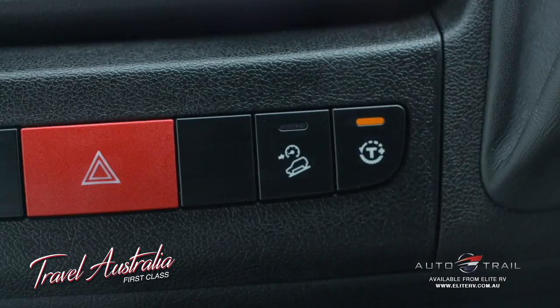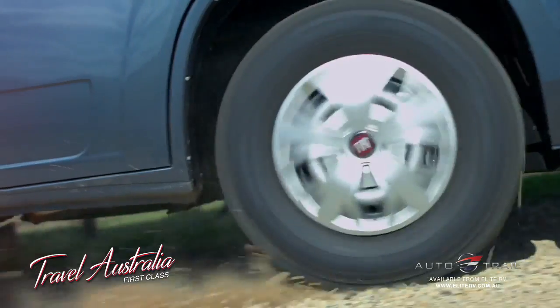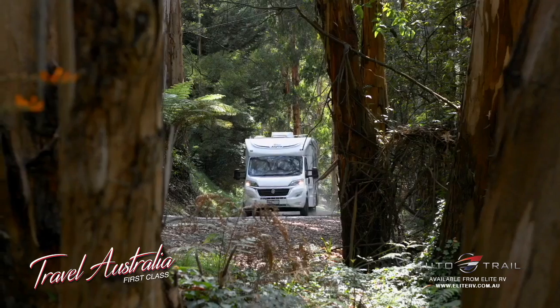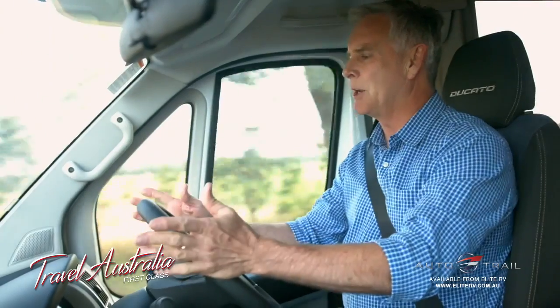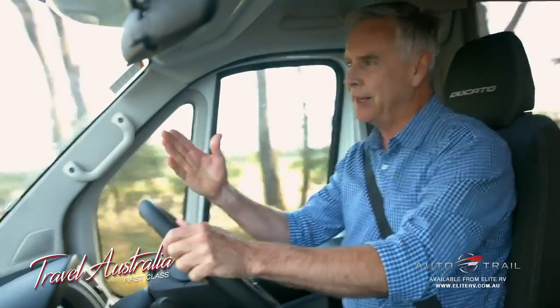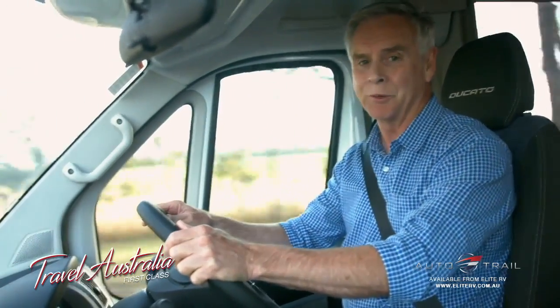Your vehicle is equipped with Traction Plus as part of the system. Traction Plus optimises available traction by applying the brake to the spinning wheel and increases traction to the other wheel. The system also controls engine power under low traction to stop the wheels spinning. It should be noted that while these systems are very sophisticated and can help maximise grip and handling, they do not override the laws of physics and cannot help irresponsible driving.